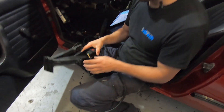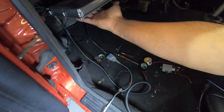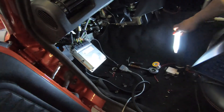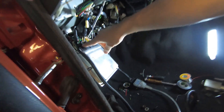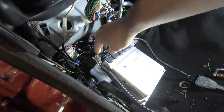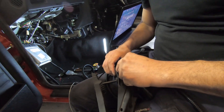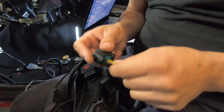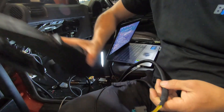So this is our accelerator pedal wiring. This is where the DME is going to sit — we're going to tuck that up nice and high there so it doesn't get in the way of the glove box. We've gotten a factory E46 plug that's got the right wiring for the accelerator pedal, and this is the correct plug for the pedal. Very straightforward — the colors of the wires here are the same colors that are coming out of the DME, so you just need to lengthen them. We run a certain length to run it across over to the side so it can reach the pedal once we install it.